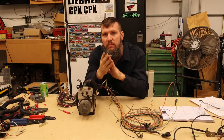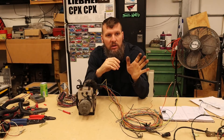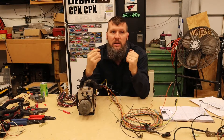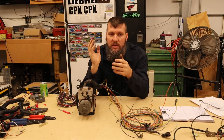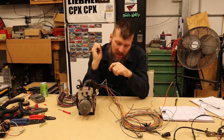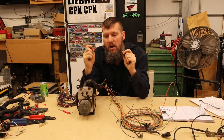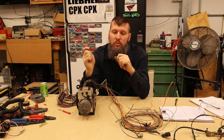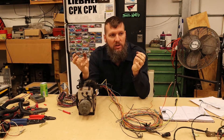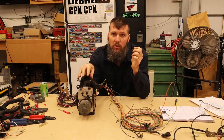The ABS. So as I've said in previous videos, the car was a base model and did not have ABS. It just has the regular proportional valve on it. I want to put ABS on the car — I think it'll be better. A lot of people delete the ABS because they want the manual brake feel. I want to hit the brake hard and not worry about locking up any of the wheels. Right now I'm constantly locking up the right front whenever heavy on the brakes, and there are probably some other things I can try to do with the balance of the car, but this is an option I've been wanting to do. I think it will help the car greatly.